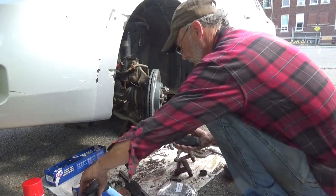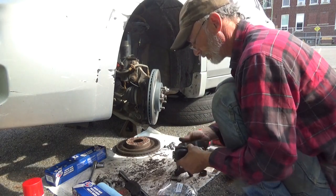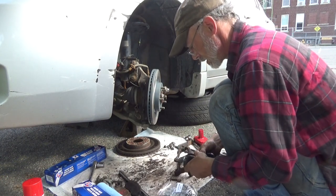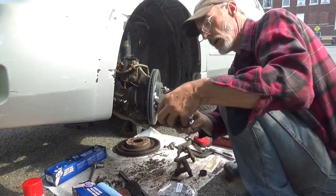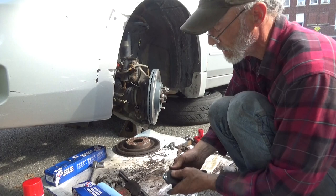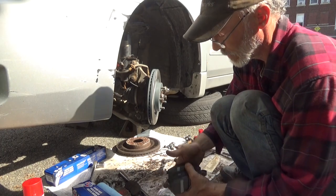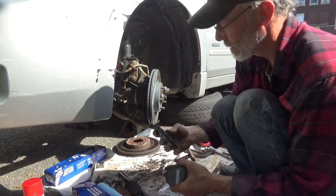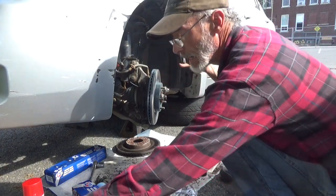Now the brake pads, let's see what we got here. So all four of them the same way. Alternate brake pads, that'll make them stack easier. All four brake pads are the same part numbers. All four brake pads are the same shape. They're all curved on the bottom. So it really doesn't matter whether these are inboard or outboard. Squealers go on the leading edge. Outboard, inboard. Well, this is one side, that's the other side.